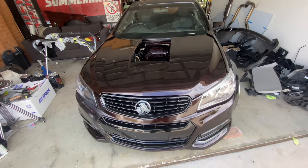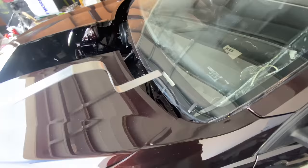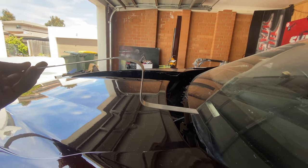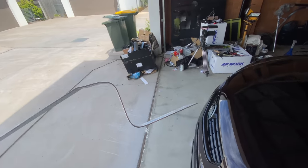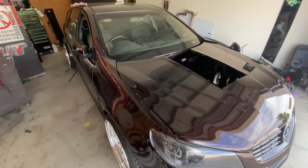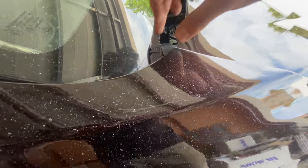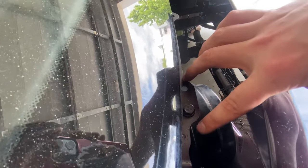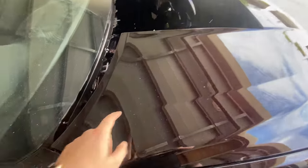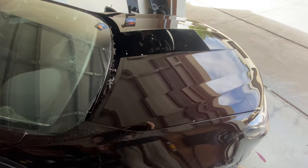I'm going to have to weld some nuts in there so that they're tall enough, which is a little bit annoying. This flat bar, which I'm slowly bending — I think I'd have it kind of coming from there and then down under the bonnet, sitting on that angle. Now this bar is too thin and flimsy to support the bonnet, but this will be what I use to make the testing piece, so I can trace it and get someone to make some thicker ones. It has to actually hold the weight of the bonnet too. I'll get a wider bar to come out from both of those holes so it can't pivot, and then come up to maybe here in this flat spot, so I'd have one here and one roughly about here. That should look pretty good, and if I need to go smaller I can make a smaller bracket.